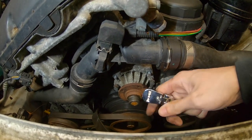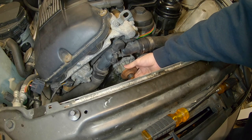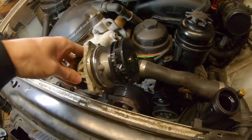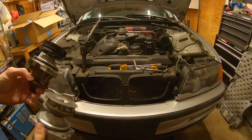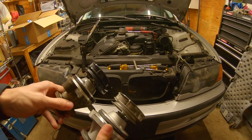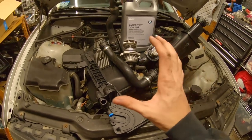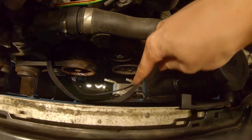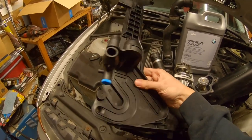Oh no, it's green — all that splash is getting caught in the bucket. It was a plastic impeller. This is the original factory water pump. I'm really happy that I'm doing this. I got the new pump out on the right here, and yeah, this is definitely plastic on the left. You can just see the size difference between the plastic and the metal. And this trim is for a manual transmission right here, so that's going to delete that automatic transmission cooler down there, because the cooler has two ports on the automatic version.